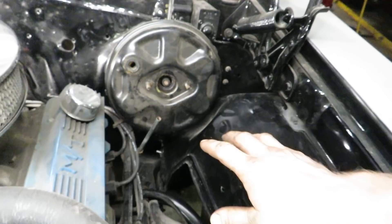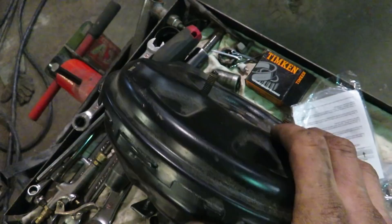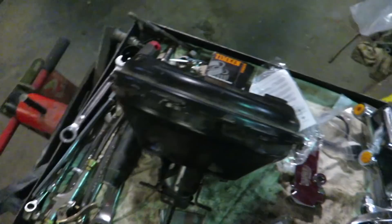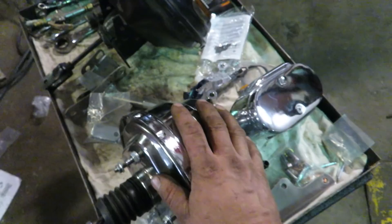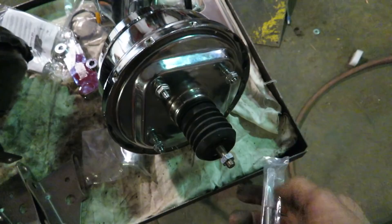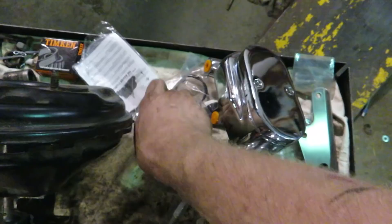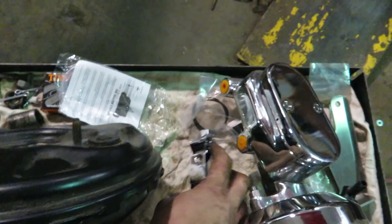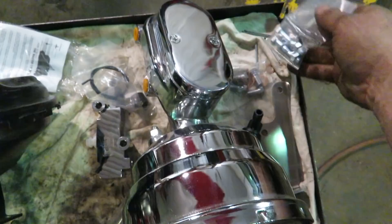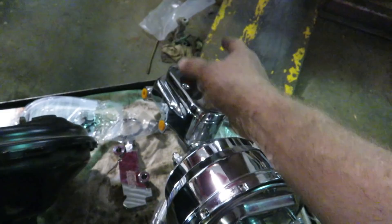Now we'll install the master and the booster that comes with the kit — that's just two little bolts at the back here. This is our old booster that somebody sanded down and painted real nice, but we're going to throw it away because it will never look like this new one. What we need to do is duplicate the rod length that comes out to your pedal. It comes with a rod that threads on, and you can cut it to whatever size you need. It also comes with a nice new clevis and pin, new brackets to mount it to the firewall, a bracket for the proportioning valve, lines to go from the proportioning valve to the master, wire for your brake wire sensor for your shuttle valve, and a bleeder for the master to bench bleed it. We're going to install it as-is, finish running our lines up to it, then bench bleed it, and install the brake lines once they're all hanging perfectly.